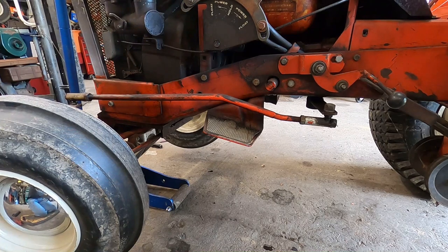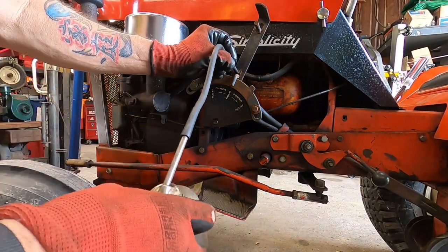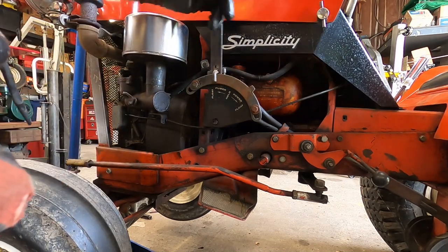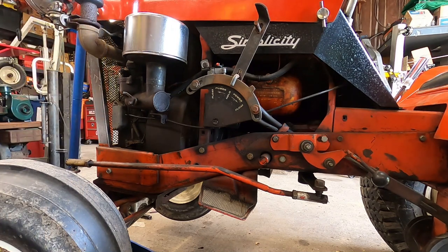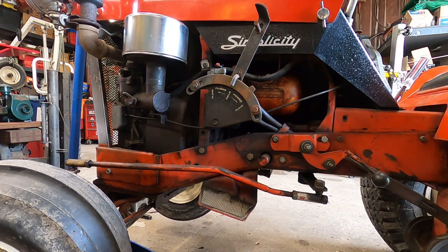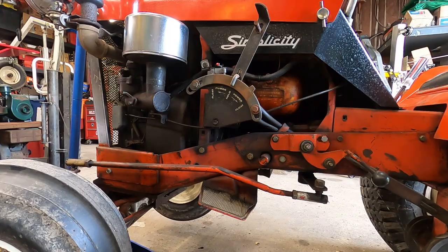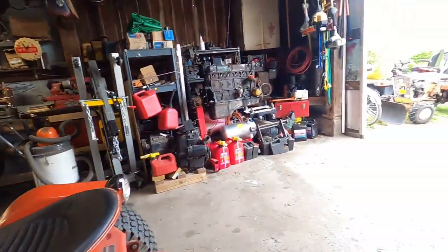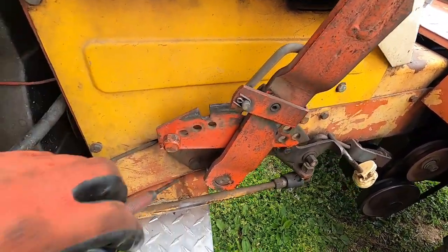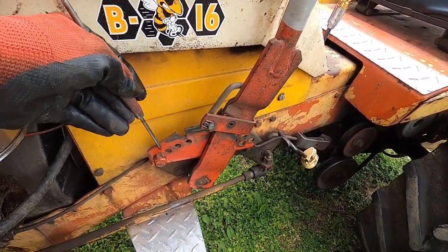If you have a hydro lift, you don't want that pivot to dry out — just the tiniest bit of oil. Anywhere that pivots gets oil. There's usually enough seepage from what I think is the pintle that you don't have to worry too much, but I'll show you. There are a couple links of chain if you have a hydro lift. If you don't, lubricate all of your pivot points on your strong arm lift instead. I also smear a little bit of grease along the shift quadrant.